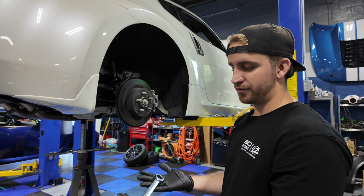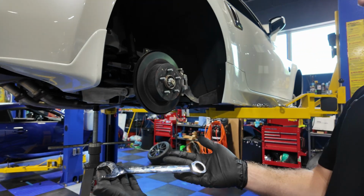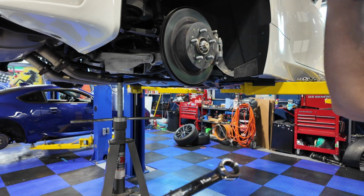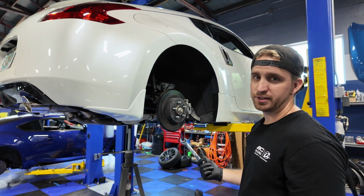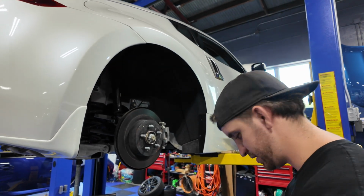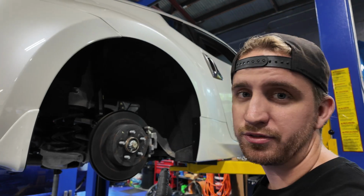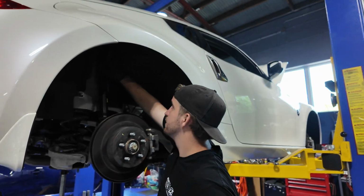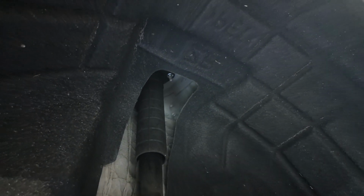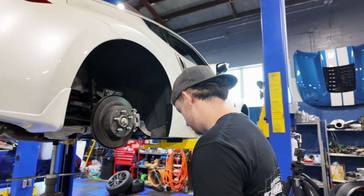So the only thing that's gonna be different from the front tools is now you need a 19mm wrench, so you can hold the other side of the bolt for the nuts. That's really the only thing you gotta add into your arsenal now. And then your 17s. I don't even think you need the 14 this time. And then a 12 for the two top studs that are up here. There's two nuts that sit up there and it'll drop it out after you disconnect. I wanna say this is a 17. Let's do it, let's get into it.